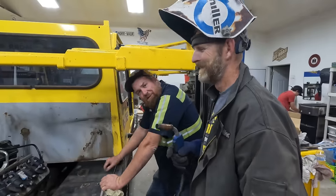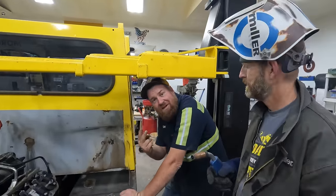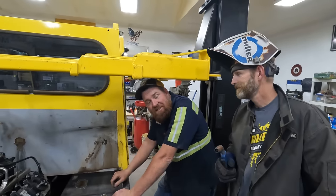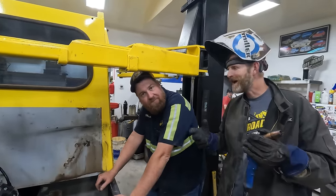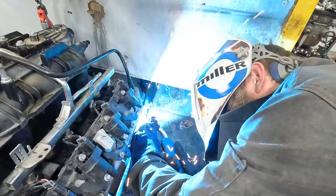So what Tom's doing is twofold. One, he's welding something on we can get a hold of, and two, he's heating the area, and the differential of the thermal expansion between the aluminum and the steel is enough that it might let go a little bit. Don't get all technical on it, Matt. We're just going to get it out.